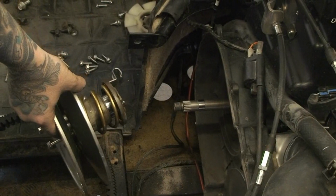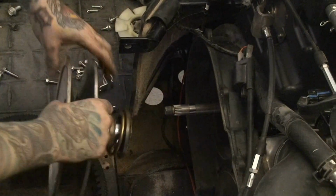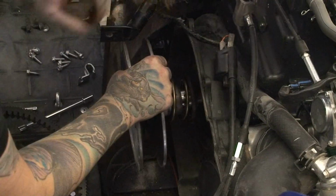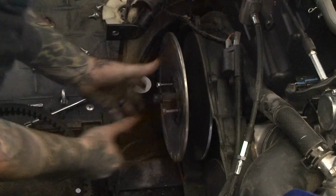After you put the cap back on the clutch and everything, get that all buttoned down, you need to reinstall the secondary back into the motor. It's as simple as just taking it back out, slide it right back in the same way, and that's that.